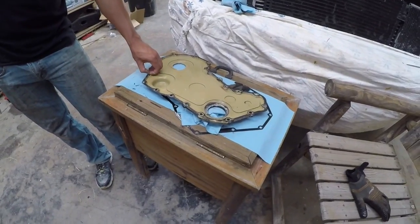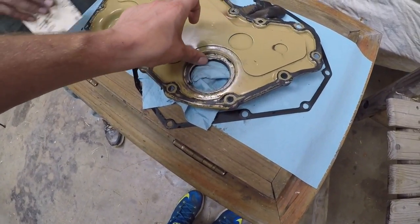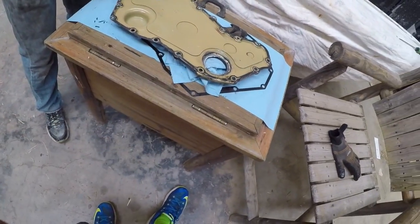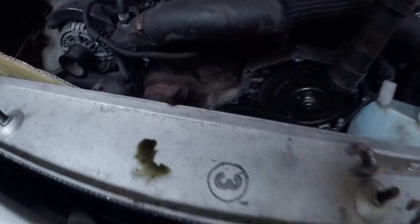It really was not dripping much oil — I probably could have left it for a really long time and just had a small oil drip. 7.3s and first gen trucks leak gobs of oil because they're just old trucks. My truck never did that before, so I wanted to investigate and make sure everything was taken care of. This back half of the crank seal was folded in while the other side was not, and that folded part was causing the light leak down at the crankshaft.